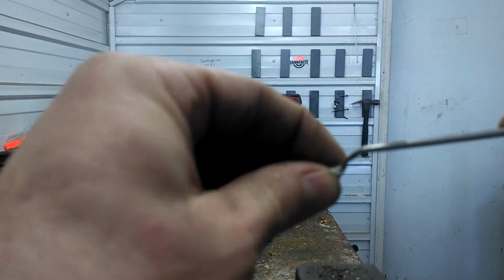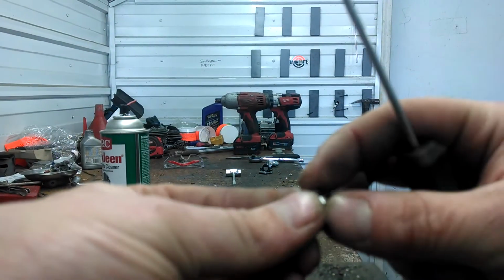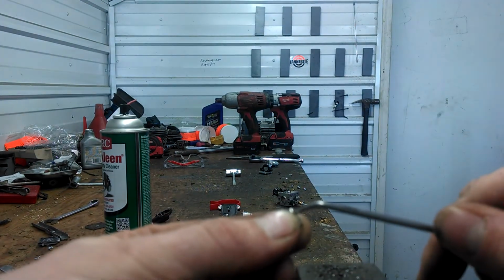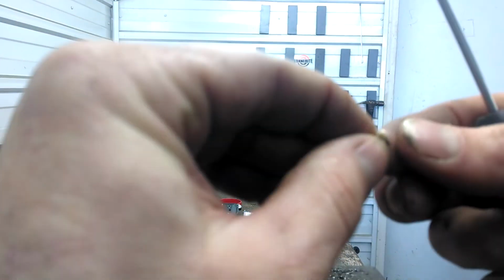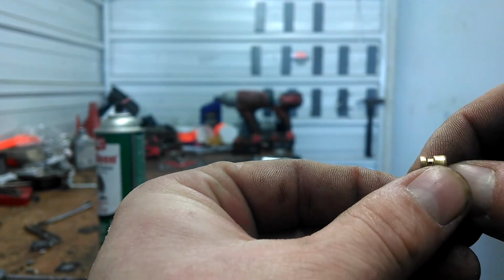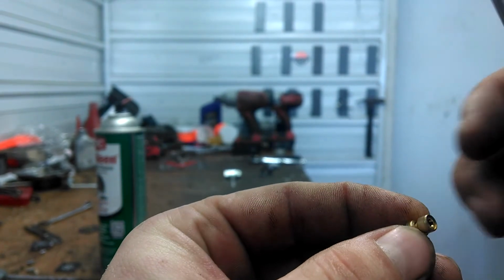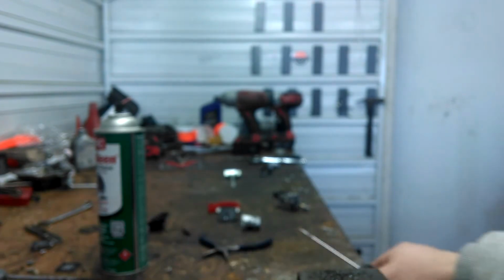There's an orifice on the top right there that pulls in underneath the diaphragm fuel, and the main feed, of course, is like a standard nozzle. It's right there when it's pressed into the body. Now the EL46 has been coming with a brass one, and there is an indentation like they intended to make an orifice there, and there's actually an indentation where it should have fed to, right there, but it does not go through. It is not a complete path.